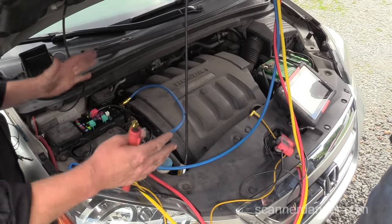Okay guys, you have no idea how difficult it is to get this shot. I have two wires — there are your two wires going to the clutch. I'm using an inspection mirror above the compressor. One of the two wires goes to a little stud. One comes around the compressor up near the radiator — the other wire is your ground. You can see those wires are intact; I was tugging on them. Getting a set of test leads up there is not going to happen easily.